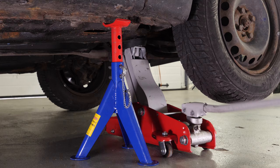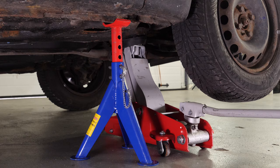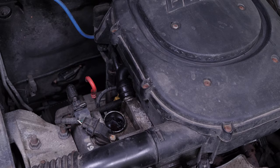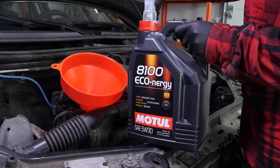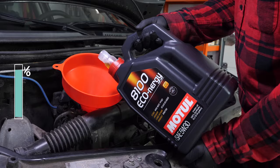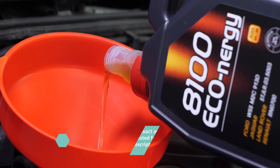Now you have to put the oil back into the motor. You have to be very careful and precise when doing this part of the job. First, put the crankcase cover back in place. Then lower your car back on the ground and check the oil level — this can only be done when the vehicle is flat. Begin by putting in 90% of the suggested amount; this will leave you a large enough margin to adjust the level appropriately. You can find the exact amount of oil suggested for your car in the description of the tutorial.